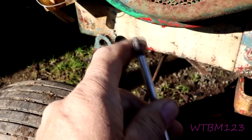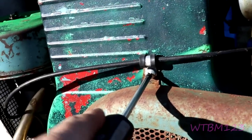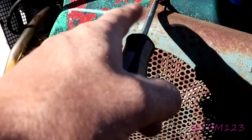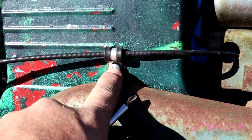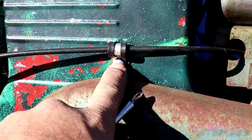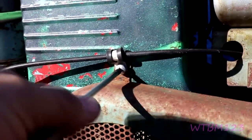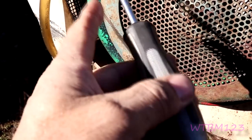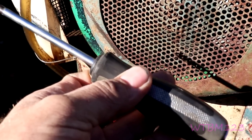This is actually a JIS — Japanese Industrial Standard — not a Phillips, but it grabs Phillips screws really well. If you smack the end with a hammer it spins the blade, just like an impact driver. A true JIS screw will have a dot on the head of it. These work awesome — even on a regular Phillips screw, if you have one stuck, you just bang the head. I think it's 12 degrees that shaft turns. Pretty cool. Anyway, let's go on to fixing the tractor.